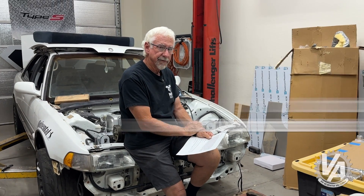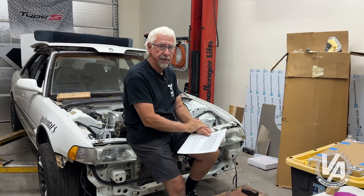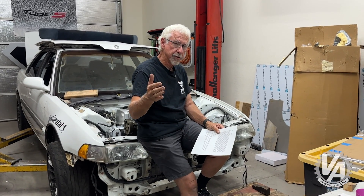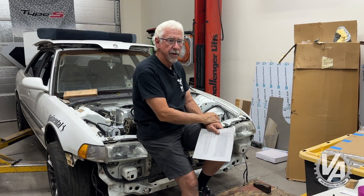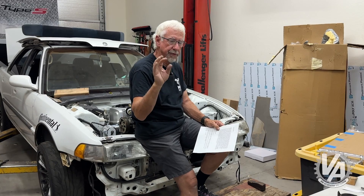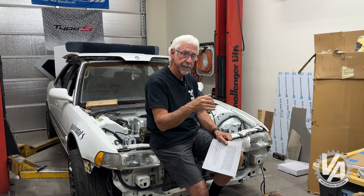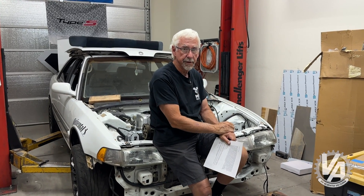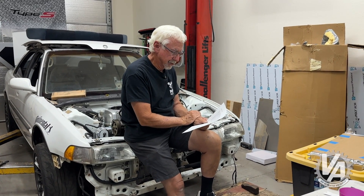The only other oddball thing about using the automatic ECU modified by Honda is you have to feed the vehicle speed sensor into the ECU. Because you're using an Accord transmission, that ECU pulses much faster. But if you have Honda modify your ECU, you're going to be able to use their internal circuitry to get an output on B11 to actually drive your speedometer to the right speed. That's what I would suggest doing.